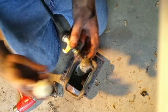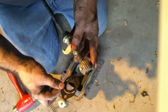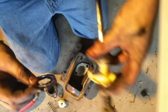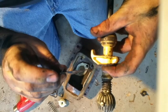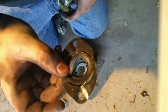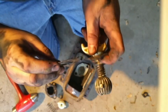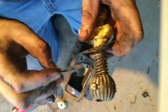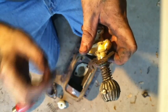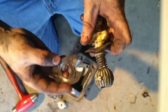It's a new ball. Make sure you put this on before you put the new ball on. If not, you have to take it back apart. Now, as a little reference, notice how these holes are bent downwards when I pull vertical like that. You notice how these holes dip down a little bit. You want the dip to go down, towards the ball. You're going to want to make sure this one's put on dipping towards the ball. This puts the pressure on the ball that keeps it in the socket. If you flip it the other way, it's a good possibility it's not going to give its pressure, and it can be a very loose and sloppy shift.